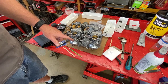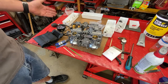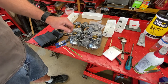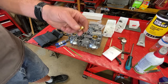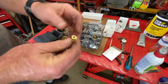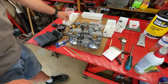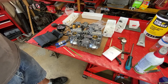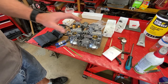Don't trust aftermarket parts. These leftover kit parts are not going to go to waste — I'll find some use for them. In some situations, depending on how much weight the float puts on the needle, they may work with a different float valve, or I might be able to use them to replace a corroded seat in another carb. I'll also use the O-rings and filter screens for other bikes. So it's not going to waste — the key is saving and labeling everything.